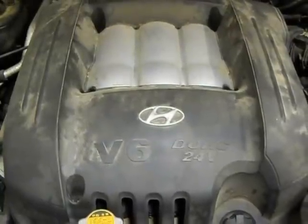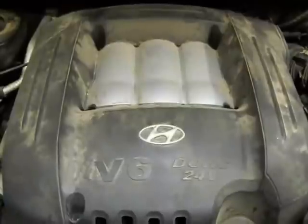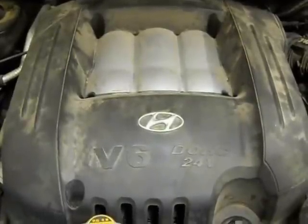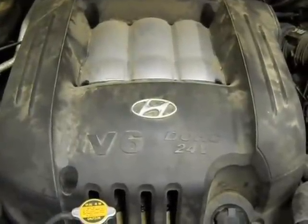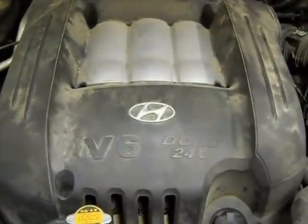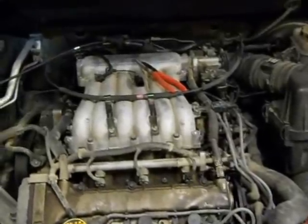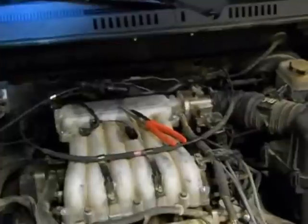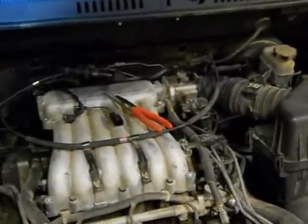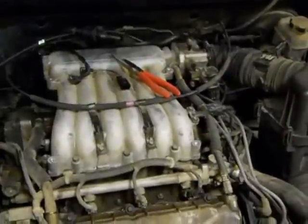There are 6 bolts you're going to have to take off in order to get to the purge control valve. It's all the way at the back underneath this cover, so you're going to need to stretch out in order to replace it here in just a minute. But first, take these 6 10 millimeter bolts off. As you can see here, we've got the engine cover taken off now. No surprises came up during that process, just the 6 10 millimeter bolts that we had talked about before.